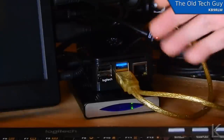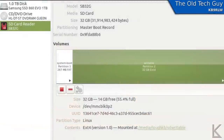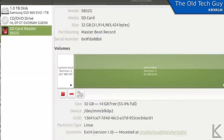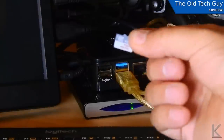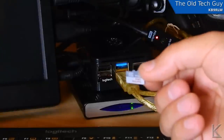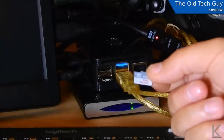So how did I get around that to get it to boot off of this? The image on the SD card contains a boot partition and a partition called Writable, which is the main operating system partition. What I did was on the SD card, I renamed the Writable partition as SD Writable, then plugged it back in and left the hard disk hooked up. As the boot process started, it read boot off of the SD card. Then when it went to go to the Writable partition, enough time had passed for the hard disk to be fully spun up and mounted and visible. The OS found it and loaded off of it, and everything runs. That's how I got around using a spinning disk with this interface.